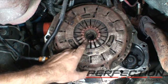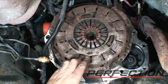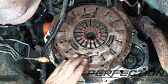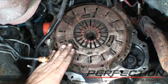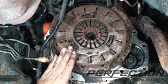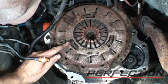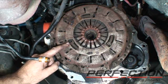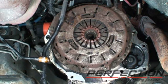The old clutch is showing some wear on the fingertips for high mileage — not unusual. These springs are part of the self-adjusting system. As the disc gets thinner, there's an automatic adjustment system inside this cover that senses the change in disc thickness, and one time you push the pedal the system ratchets or ramps out and adjusts itself. Because this little saddle on the finger is almost fully extended, we're just a very short time away from this system slipping and no longer transmitting torque. This is a fully worn out system.